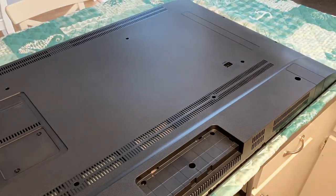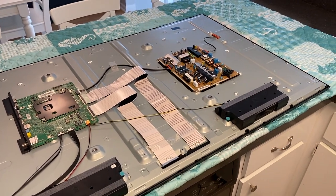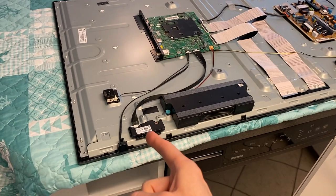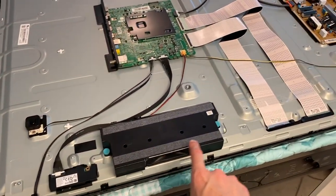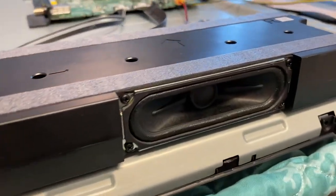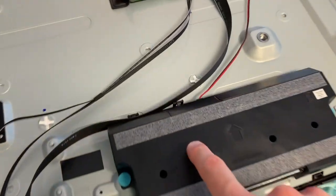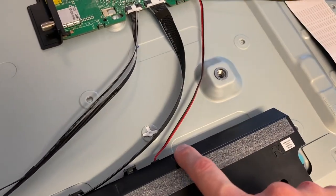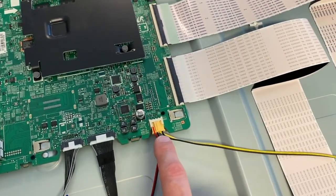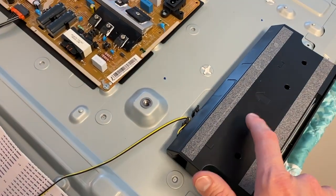We'll go ahead and pull this off with both hands. With that back panel removed, check out everything you've got access to — all the wiring. You've got your power board, your main board, your Wi-Fi module, your sensor, your power button. These big blocks here are your speakers. Yours might be damaged or blown. And feeding off of each speaker on the left-hand side, you've got a red and black wire that feed into a connection point to your main board, and a black and yellow wire that goes all the way to your other speaker.